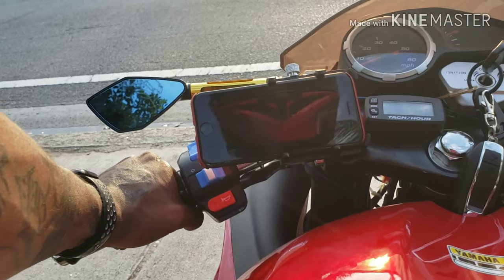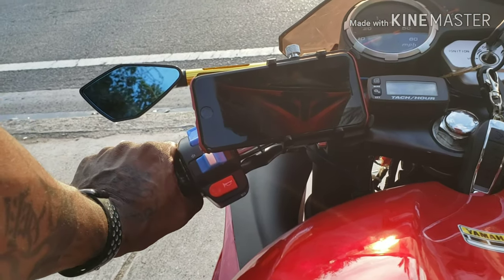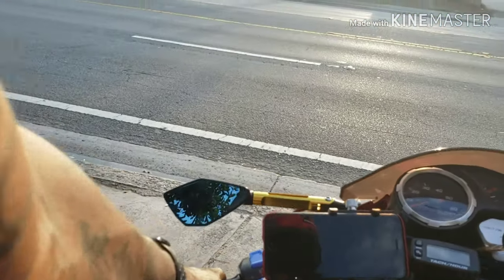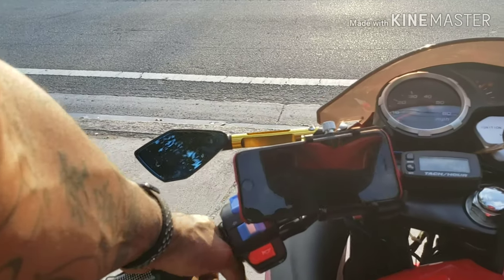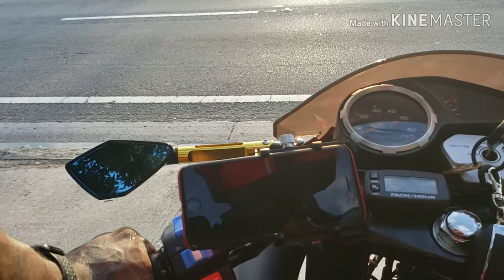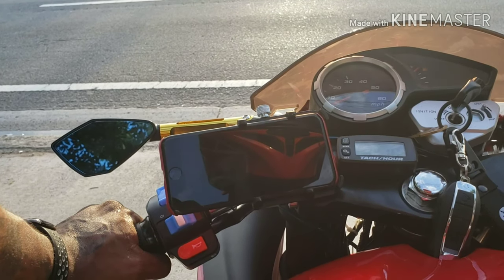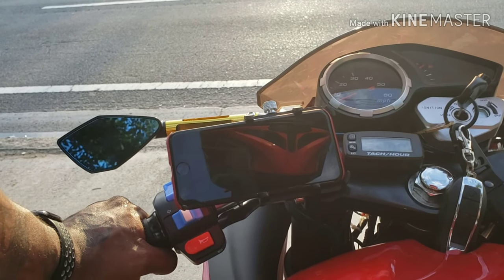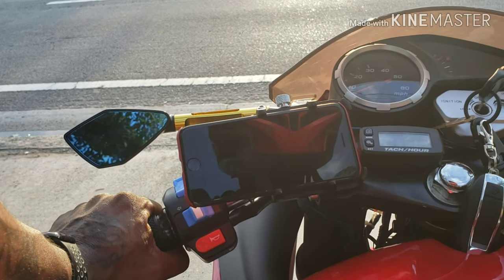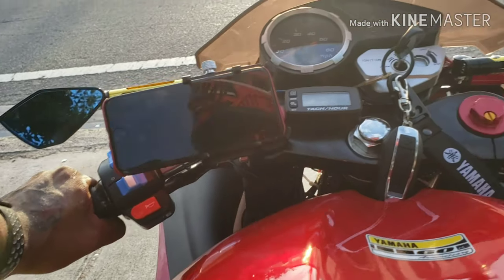But yeah, so I changed them to 11 and 10 grams because I want to see if the heavier roller weights will work, because the RPMs are getting too high with this clutch spring in, and with the 2000 one, it didn't get that high. But then again, I did tune the advance on the timing. I was about to go, but let me wait till this guy goes.